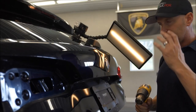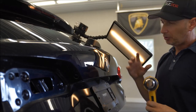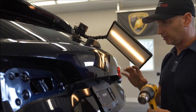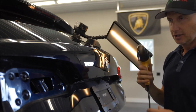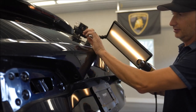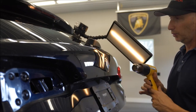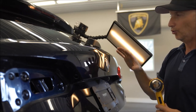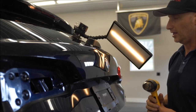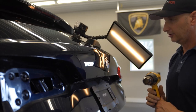We've been tapping it down, glue-pulling it, doing some more tapping. It's not really glue-pulling the way I'm liking, so I'm going to start pushing with a metal rod — just get in there and start moving things around. I'm going to heat it up first, especially near the body line going through there. That's a deep part with that body line. We want to make sure the paint is nice and warm and pliable so it doesn't crack when it's working its way out. So we'll heat it up and start pushing with metal rods.